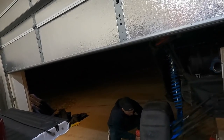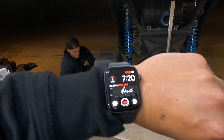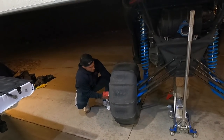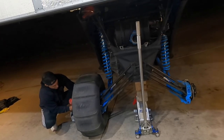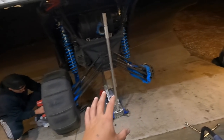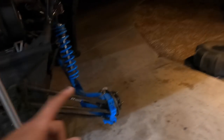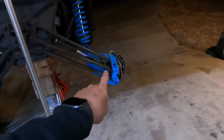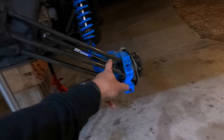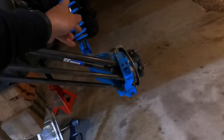The way that I would do it — it's currently 7:20. Taking a quick glance at this, how I personally would pull the CV off: obviously take the wheel off, pull these arms out and see if I can twist this, or just pop that bottom shock out, pull these arms out, and just pull this thing out. You probably just got a little nut right here and then you could just yank it out.